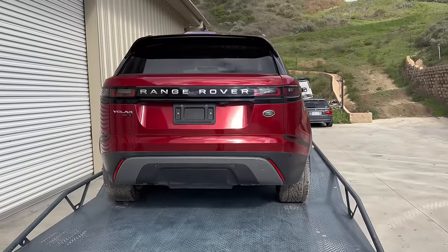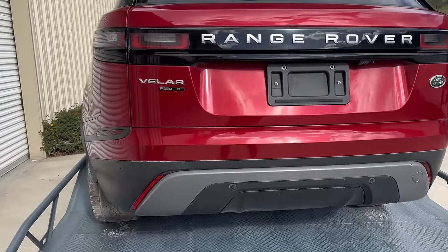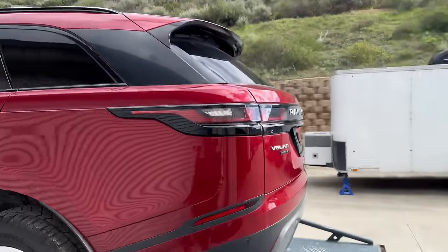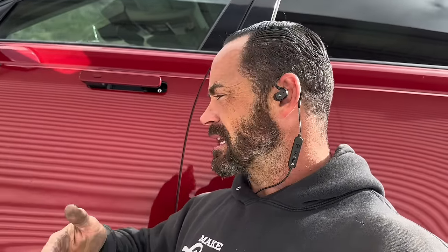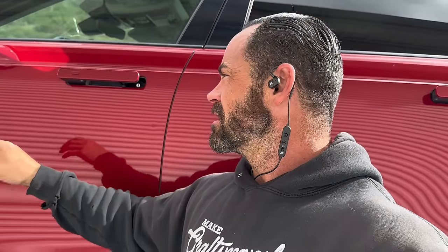This will be perfect rear engine. There are a lot of good aesthetic and styling treatments on this thing already. We really wanted just the interior portion — just the front of the interior done, A pillar to B pillar. We knew we were going to get some kind of a collision car for obvious reasons, and the front collision is perfect because the front is going to get stretched four inches. The wheelbase — the hood and grille and everything — will be four inches further forward than stock, which is a lot for just the clearancing issues with the wheels and tires. So with the collision, we knew there would be some kind of airbag damage in there.